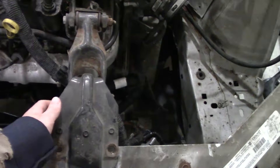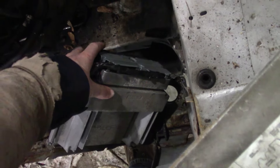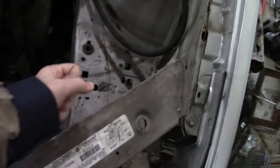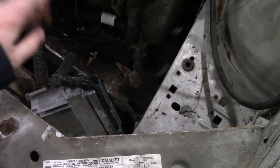Other than that, everything else on your pulley system is identical — alternator in the back, water pump, power steering, air conditioning, all the good stuff in the exact same order. Now, electrical is just a little bit different. We did have the computer, which is right here just hanging out. This was in the air box right here — got to be careful because you can't just grab the air box and rip it right out of this car. We almost made that mistake; I was going to grab it and noticed this air box was really heavy and there's this massive bundle of wires that's not letting it go. So we followed those, found the computer inside, took that out and it will get moved somewhere safe.